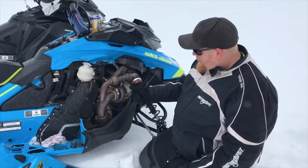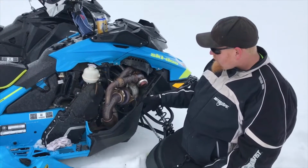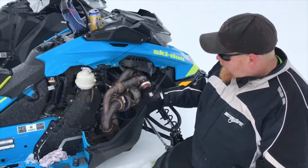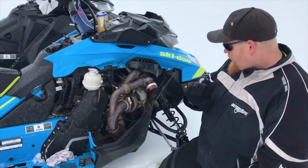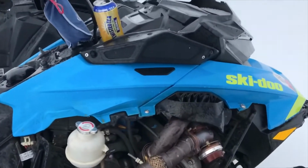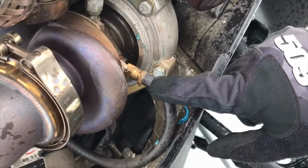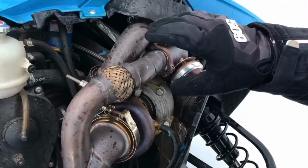So, in all reality, I've melted this piece on here. So you need to wrap tape on this. That aluminum foil wrap needs to go on here. I haven't done it. If you want to come in and look at this fitting, this is a yellow push pin fitting. You can see how it's all melted. That has melted off, and then I'll have to take the sled apart.